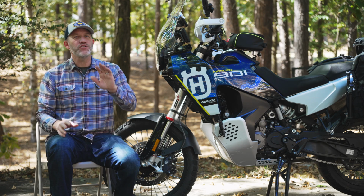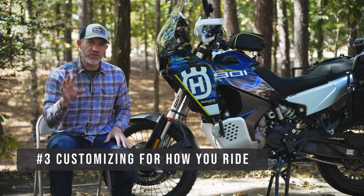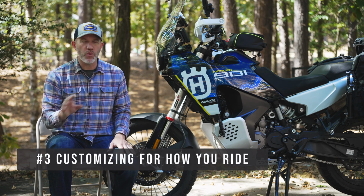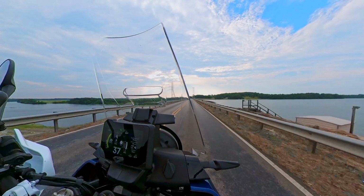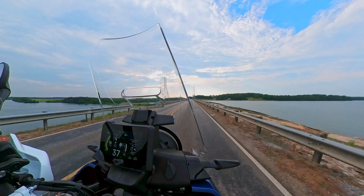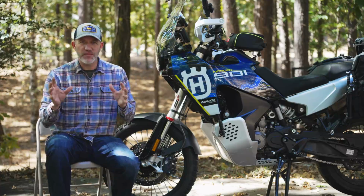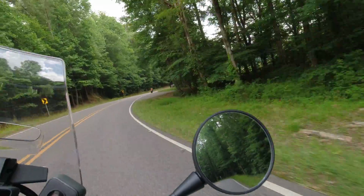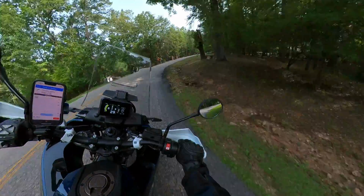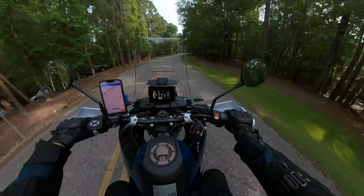Okay, so those are the standard settings, but point number 3, how do you adjust the suspension to specifically suit your style of riding or situation? Now for me, the comfort setting is absolutely worthless. It's only for riding the bike very gently, and even then it feels a little wieldy and bouncy. The standard setting was kind of my starting point just because it seemed the most generic and widely used. Sport does help prevent some of the brake dive that you get because it does stiffen up the front fork tubes, but I did find that a little bit aggressive for my style of riding.